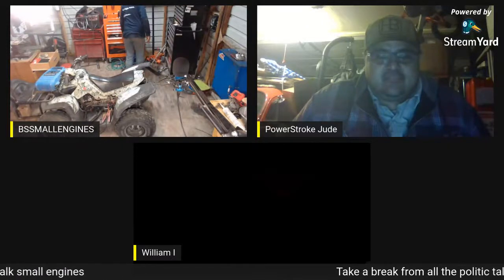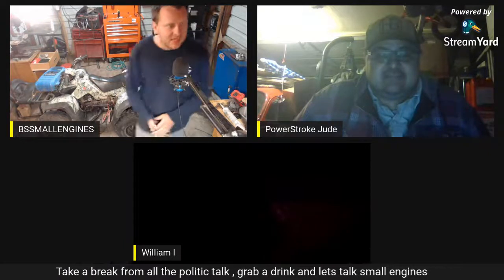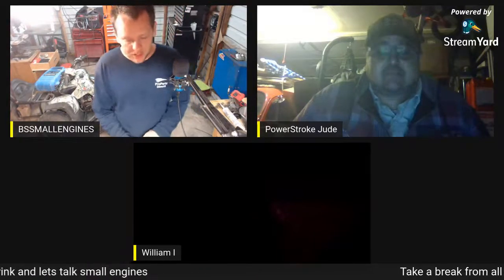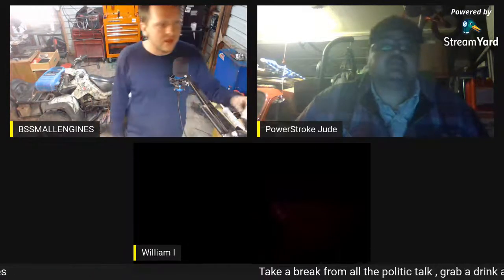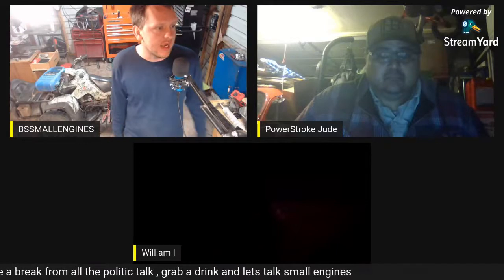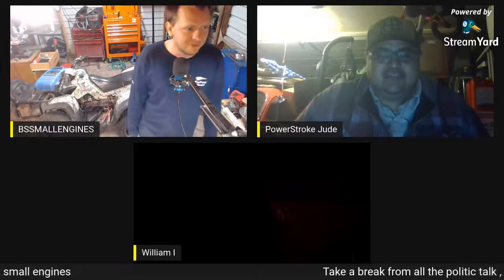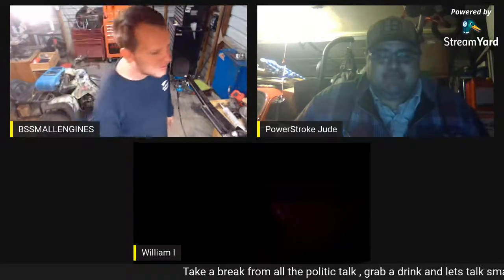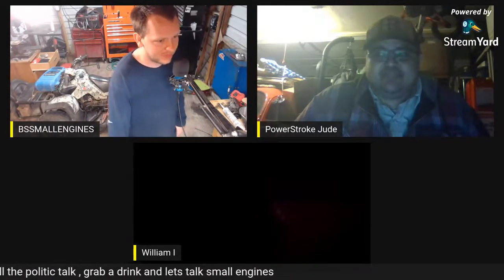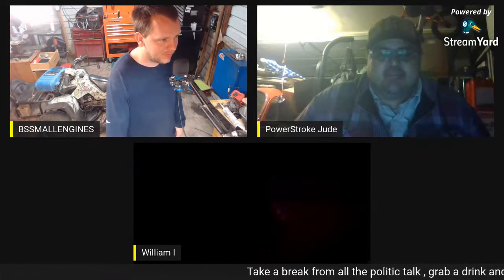I know what I'm thinking about. I don't know where the heck. Oh, I know where it is. It's in my tool bag. I had to go on that same Dodge Charger with the knocking noise. Before that, he took it into a Dodge dealership for the alternator recall, and they sent it back and didn't put the main wire back on the alternator. So it was just hanging there, sparking against the manifold. I had to put the wire back. Like you said, man, double check your work.